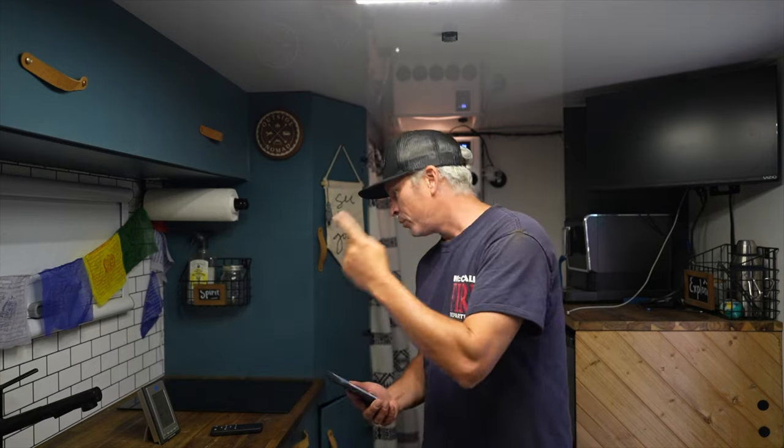I'm going to step outside — we're still at 84 degrees. I'll come back in maybe 15 minutes or so. It's been about 10 minutes and we're down almost 10 degrees — we're at 75, started at 84. We have chewed through 8 amps of battery on this 24-volt system, which would be the equivalent of 16 amps on a 12-volt system.